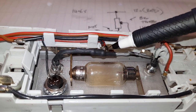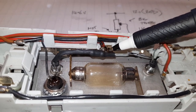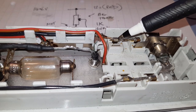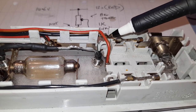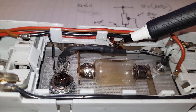So that's the positive supply, the 16-minute supply, it's called. Lift the door handle, it's on. Drive and drive. And it only goes off when it's been locked for 16 minutes. And our negative supply we take off of here, which is the backside of the switches. And there's a sort of bare bit of wire here, which is great to solder onto. So negative supply, and the 16-minute 12-volt supply.